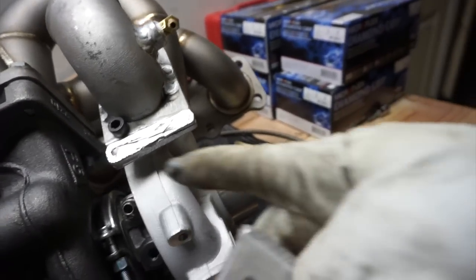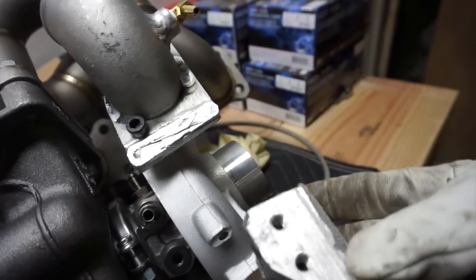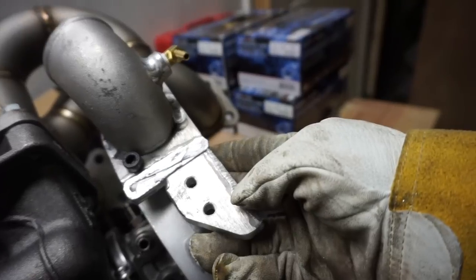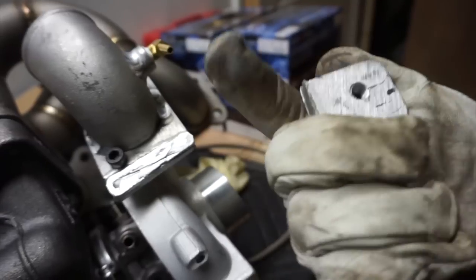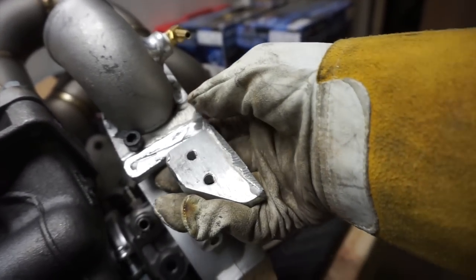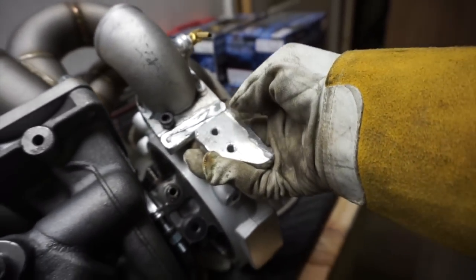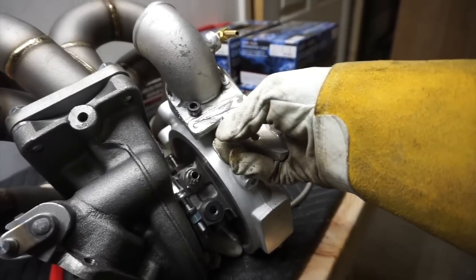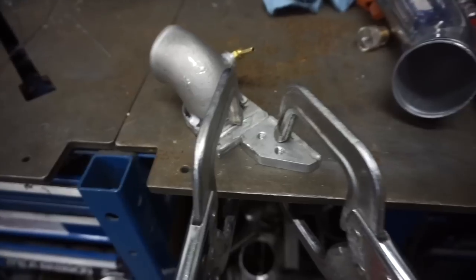So one hour later — I just chopped this off clean. I left some material on there because the more material, the less welding I have to do. I have to fill it up like this, fill these holes on each side, and re-thread or just make it bolt-and-nut because it's just too much time otherwise. I also have to add more filler here to hold it all together — I'll just heat it up.